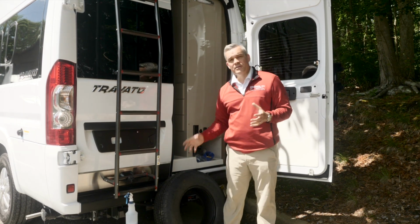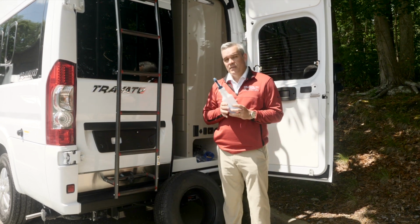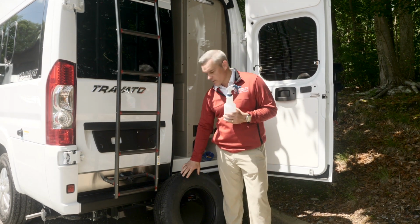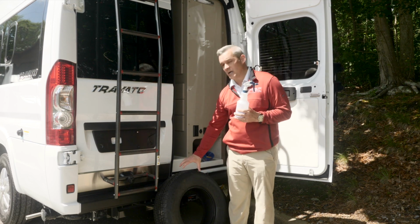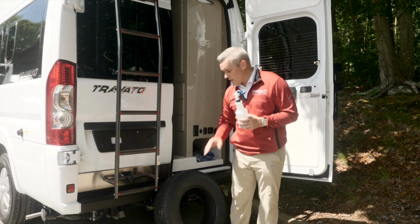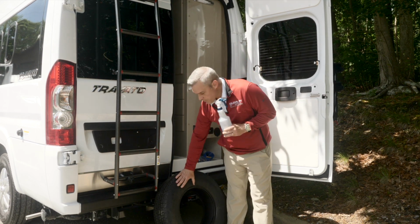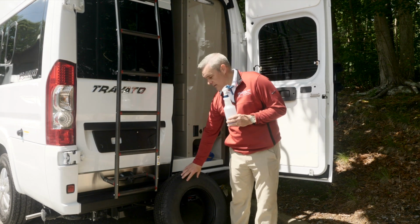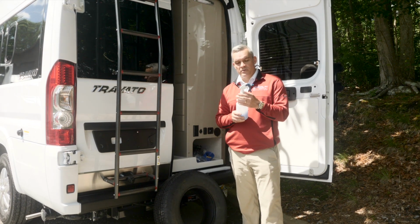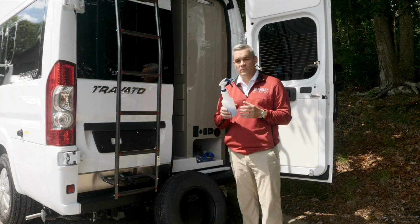Lastly, what we all like to do when we clean our vehicles is apply tire dressings. You're going to want to be very careful because there are some tire shines and products out there that have a lot of alcohols and silicones. If you continuously apply them to your tires to give them that real bright shine, make sure the product doesn't have excessive amounts of either. There are others that don't have that, and they will clean your tire and make it look nice and black. But some products will actually break down the rubber and all of those waxes, and that will help to age the tire faster than we would think. So you want to be cautious of what tire products you're applying, because again, you want to make sure the life of the tire is protected and you're not breaking it down with the alcohols and the silicones.